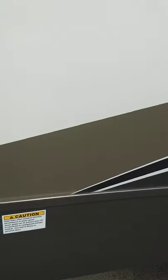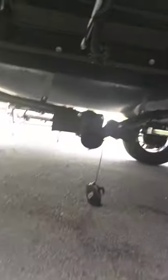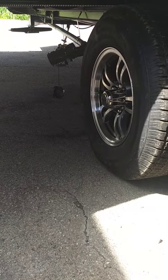Going past your slide room, you have a galley tank drain — the galley tank is a second gray tank. You can see it right there. The other one over there is your gray and your black tank. The bottom line is you always pull the black tank valve first because it's toilet water and waste; the gray tank is sink and shower water.